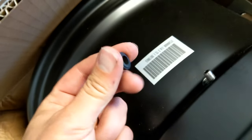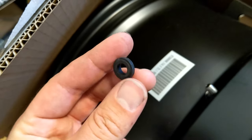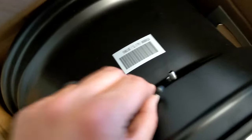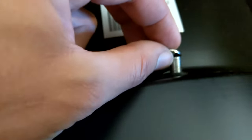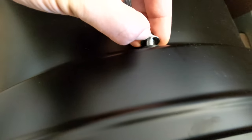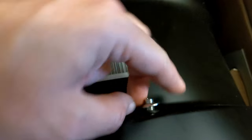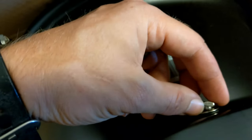Make sure with these gaskets you always note the ridge. It has a flat side and a bigger side — the small side goes on the inside so it fits inside the hole. Then you have the washer going over it; the cup side of the washer always fits around the gasket. You can see how it has that dish shape to it — it fits around the gasket, and that assembly goes on the inside of the wheel.